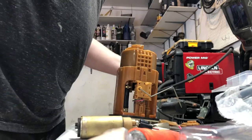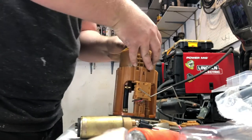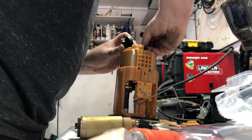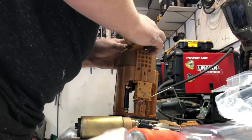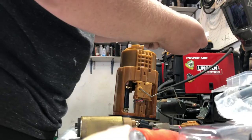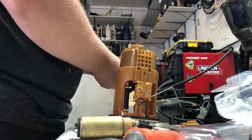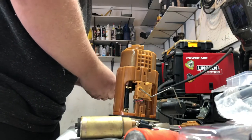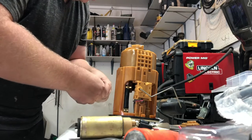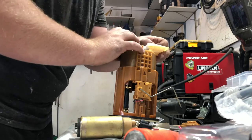So let's put this rubber isolator back in where it was. We're gonna pull the sock fitting off the top. When I did my Nissan it came with the wrong sock — this one looks like it came with the right sock. It comes with multiple socks, so just toss the ones you don't want. It also comes with a new snap ring, so you don't have to worry about bending or breaking the old one.